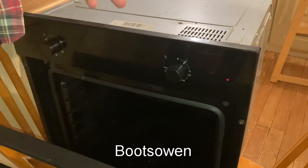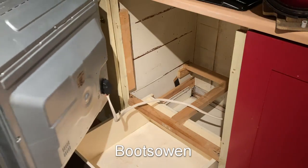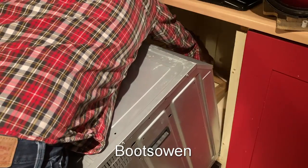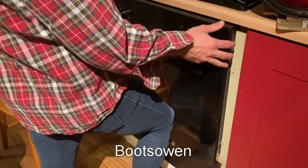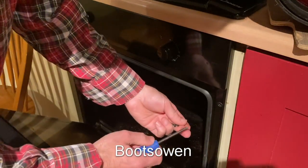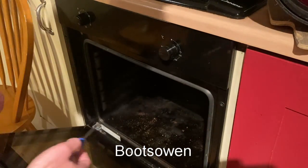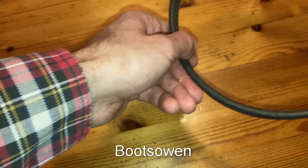So I'll turn the power off, install it again. I've turned off the power again. I've got it all ready to go back. The issue here is just not to pinch the cable. Unless you're really tight for space, that shouldn't be an issue. So the last 2 screws are the ones on either side. They should go into the existing holes. Some ovens have 4 screws, one here and one lower down on each side. Some have just 2. Somebody should really clean that oven.